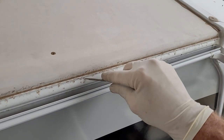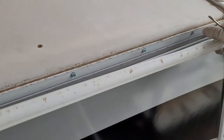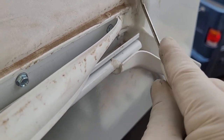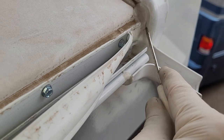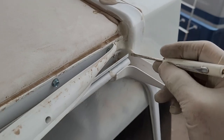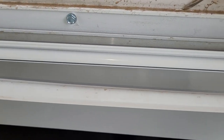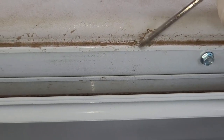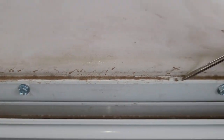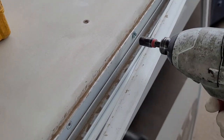First step is pull this insert molding out — this is mostly decorative. And this is going to be, it feels like a ProFlex — just white ProFlex, so it's not silicone, it's not Dicor. These are quarter-inch tech screws, just pull out all of those. And then right there — that feels like non-sagging Dicor sealant. It's very gummy. There's a lot more to go.